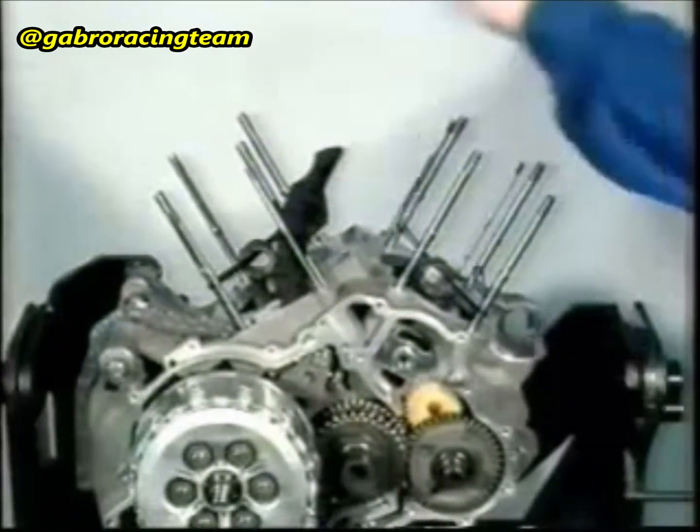Tighten crossways. The tightening torque is 11 Newton-meter. If worn, 10 stud bolts need to be replaced, apply Loctite 243. Tighten the stud bolts in the crankcase with a 25 Newton-meter tightening torque. Attention! The stud bolts on the chain compartment side are 180 mm in length. The other stud bolts measure 174 mm.